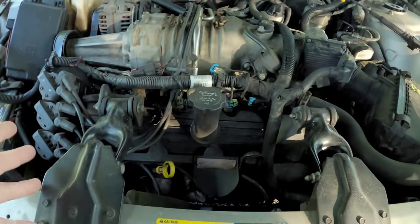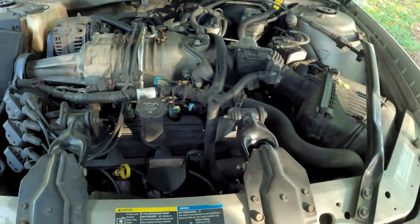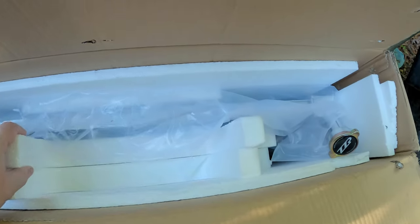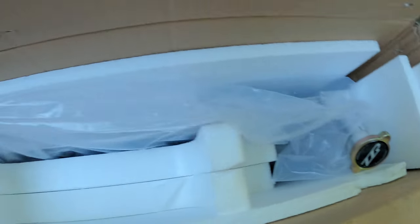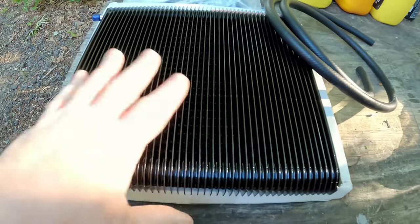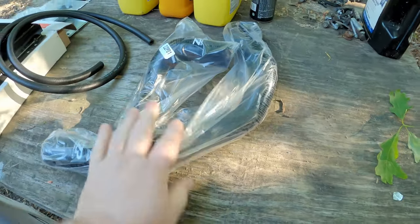This makes me think we have a partially clogged radiator. Also, the trans temp in the same circumstance is creeping up — I'm seeing as high as 210 degrees. So I'm going to do the reasonable thing: we're putting in a ZZP all-aluminum double-thick radiator, a True Cool transmission fluid cooler, and some silicone radiator hoses. We'll look at all that later.